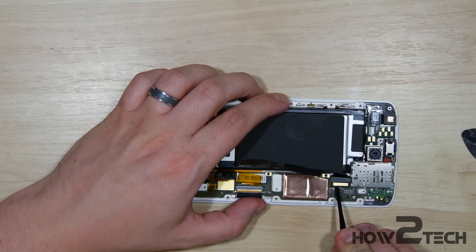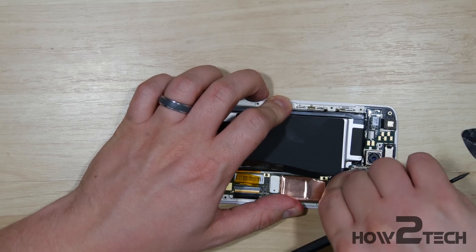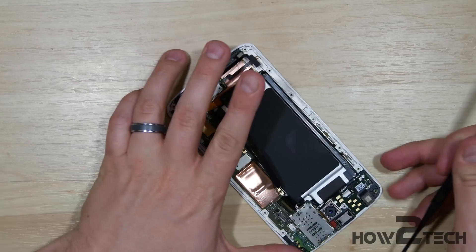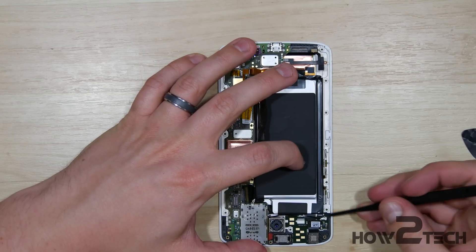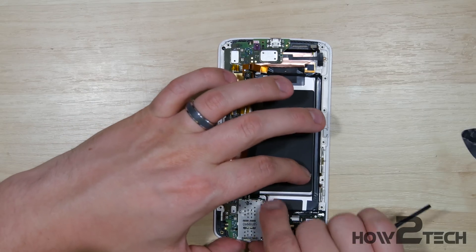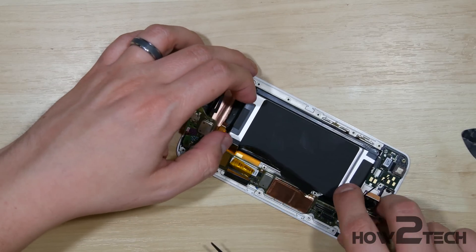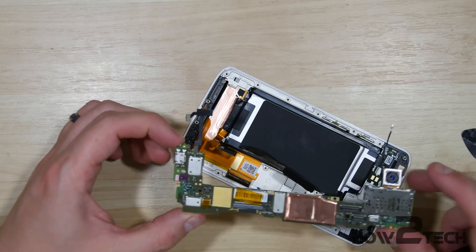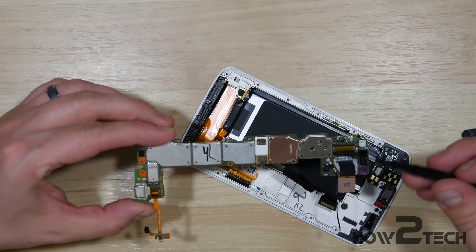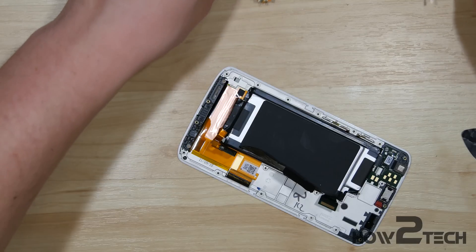I'm going to pull up this connector here — I'm guessing this one is for the power button and volume button, and it looks like it runs underneath the battery. It looks like our board should pop out. We have one more connector here — this wire cable antenna connector — so I'm going to pop that off as well. It's got a little guide slot that it's adhered to, so I'll pop that up. Then we can go ahead and remove the logic board out of the phone — we're going to tip it backwards towards the side of the phone and then pull it off of that ribbon cable connector. There we go — we have our logic board out of the phone. Our rear-facing camera uses the same kind of pop-up slot connector, so we do need to replace that. Just pull the tape up and do it just like we did the display cable and the digitizer cable. We can go ahead and set that piece aside.